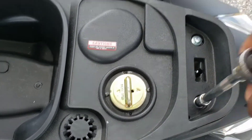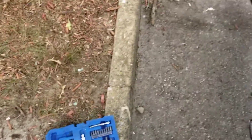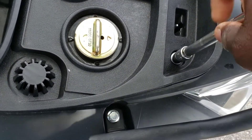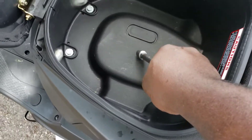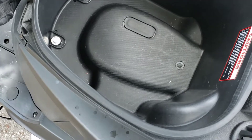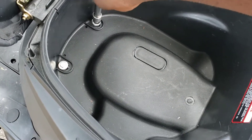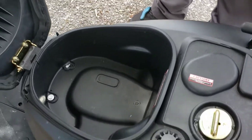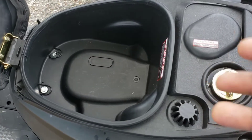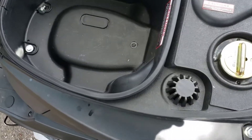So what's he doing to my bike? He's going to make it a little bit richer — he's going to be dialing the idle needle in the carburetor. He just added a CDI box, which basically removes the rev limiter so there's no rev limiter at all — he can rev as much as he wants, and that gives him more power. But everything you add requires something to be adjusted. In this case, we're going to give him a little more fuel, because with the CDI box revving so high, it's not getting the extra power that the CDI box is unleashing. By doing so, we're going to make it just a little bit richer to give him some extra power out of it.